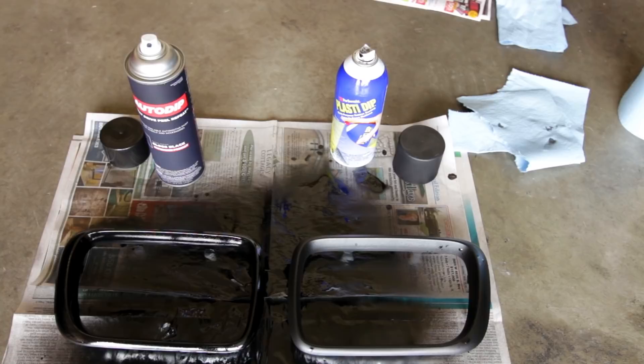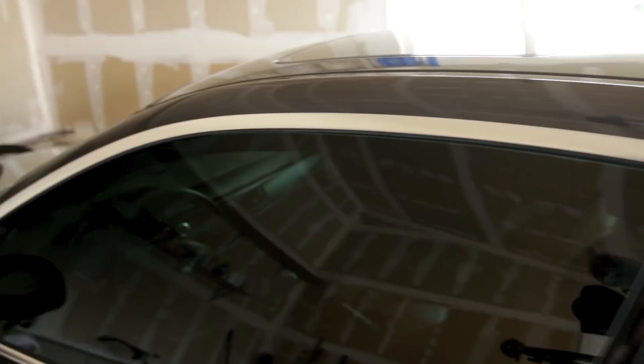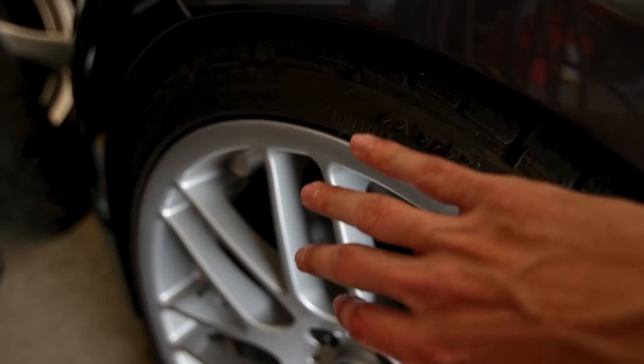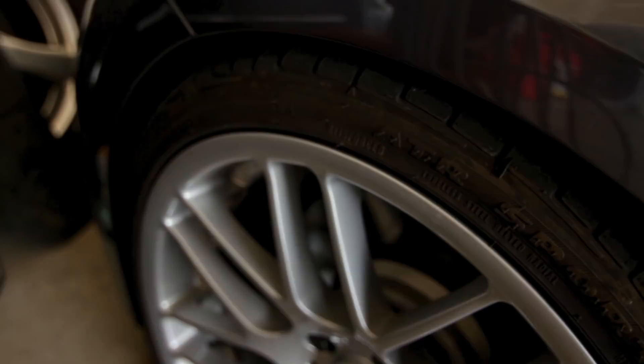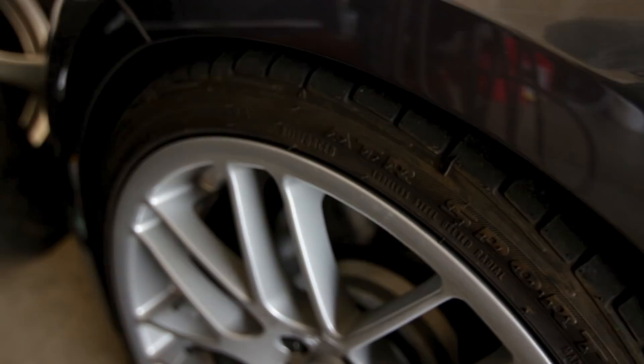While we're applying a few more coats and waiting for those to dry, let's talk about some uses for Plasti Dip or Auto Dip you may want to try. For instance, on this E92 BMW 335i we have aluminum trim — if you wanted to black that out, your options may be wrapping, normal painting, or you could tape off the windows and the rest of the car and use Plasti Dip or Auto Dip, and you can rest assured it's not going to chip off. And like I mentioned, you can paint wheels with Auto Dip or Plasti Dip. The advantage over powder coating or painting is that a lot of tires — especially if you're stretching your tires — don't have a lip that covers the edge, and you might find that soon after painting them you have a bunch of little chips around the edge. If you do Plasti Dip or Auto Dip with enough coats, that's not going to happen.